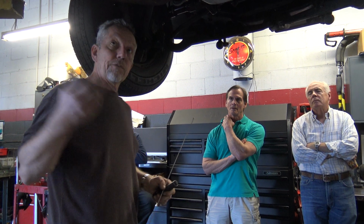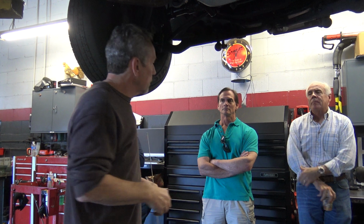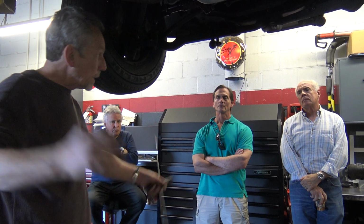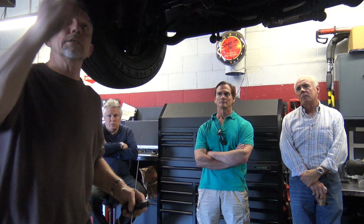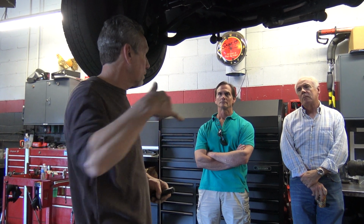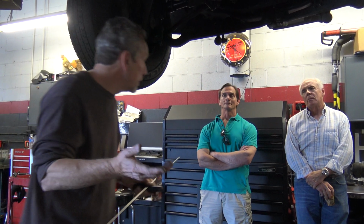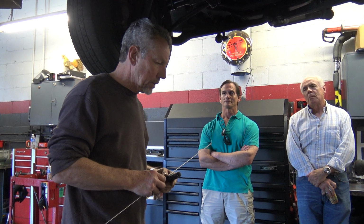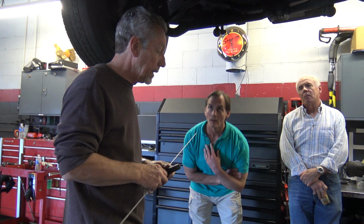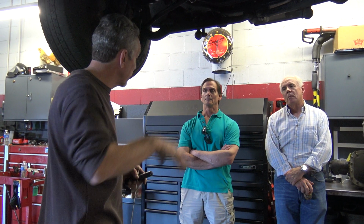Right. And the big difference on those is I think the 350 doesn't have that center support. These were like truck transmissions, big Cadillac transmissions. The internal parts are all the same. Tail housings and bell housings are different because they don't bolt up, I don't think, the same. Great transmission. 3-speed though. And then they went to the 700 later on. I think it was 700? No, the 4L80 was the next version they went to, which was a 4-speed computer-controlled transmission.